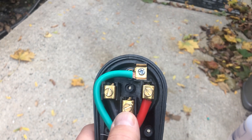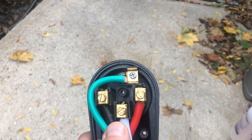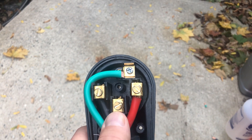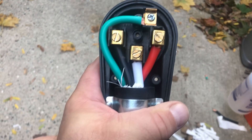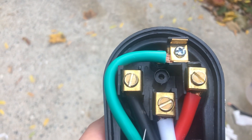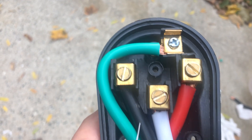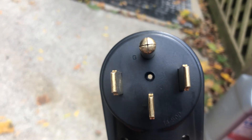What you're looking at right now is the correct wiring. What happened was, when I took the cord off the camper and brought it inside the house — it was raining that day — where the white is currently, I put the ground there, and then the white was up top where the ground is supposed to be. If you look closely along the back, you can see where it says 'green,' and if I flip this over you can see G for green.